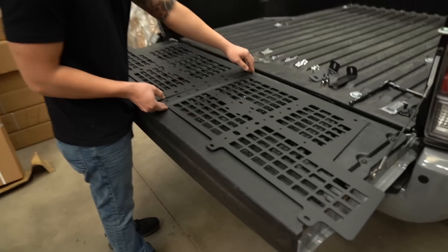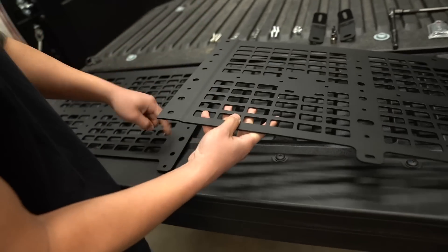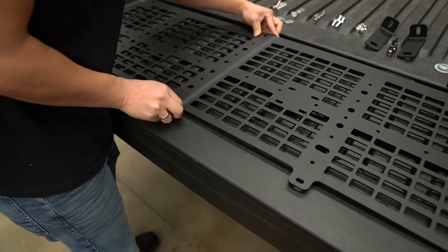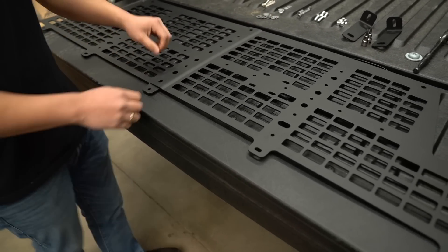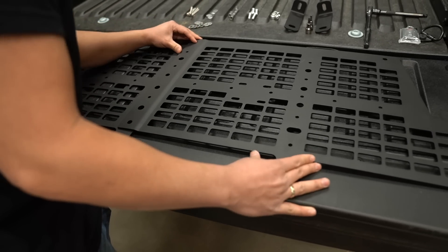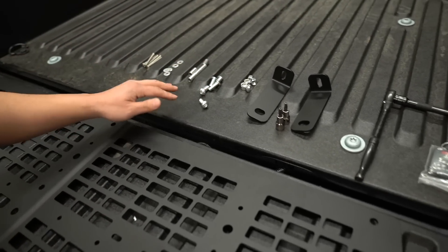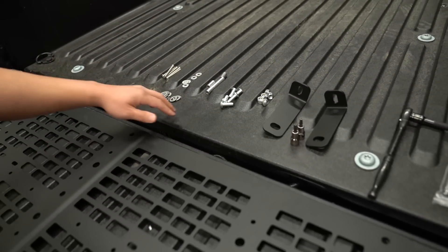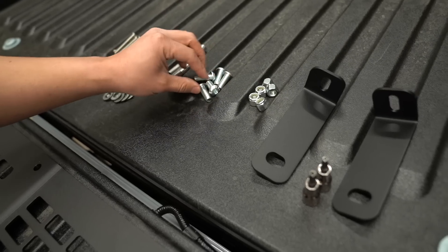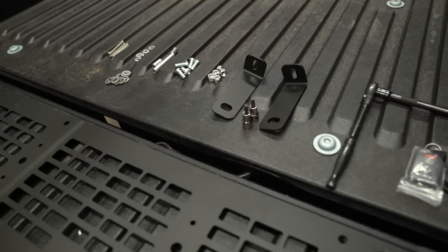If you look at these two pieces, one of them has a slant in the middle, and that slant piece is going to sit on top of the other piece so that you can have a flush feel to it from the front side. This will be the back side. You'll line up all the holes and use the very top, very center, and the very bottom hole. Here is all the hardware that comes for just the piece that goes against the cab: some long skinny bolts, washers, bigger washers, spacers, short bolts, nuts, and two brackets that will sit on the two bed bolts.